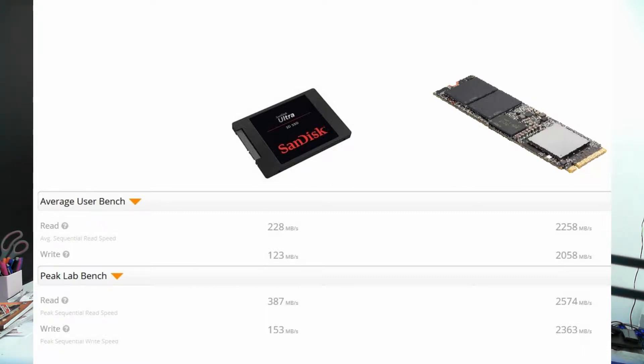It actually took me quite a bit of time running around and looking into why this is the case — checking drivers and all other options. It turns out that some of the older motherboards that had M2 slots didn't actually have support for all the lanes, and therefore it limited the speed that the hard drive could actually use. In this case, the motherboard on the video editing server had this same issue.